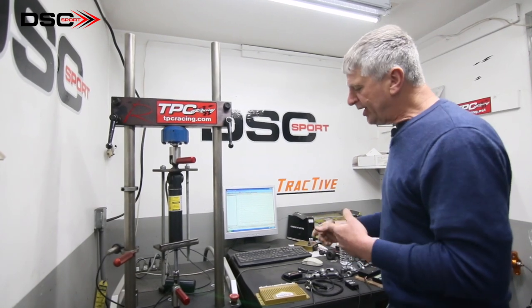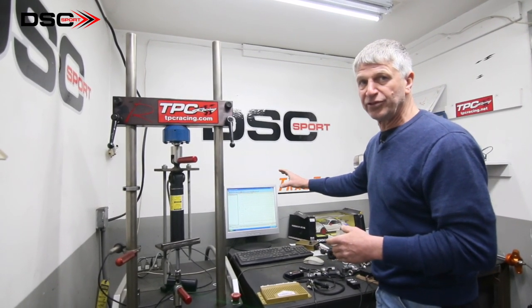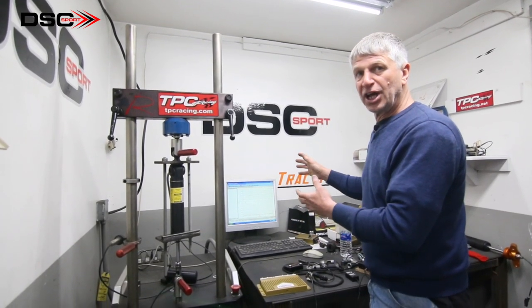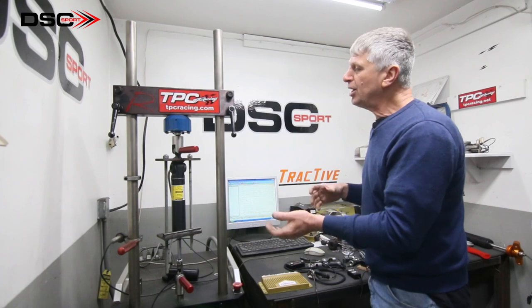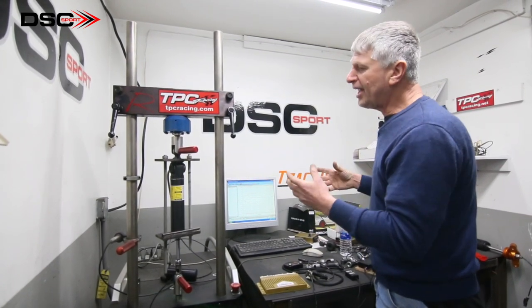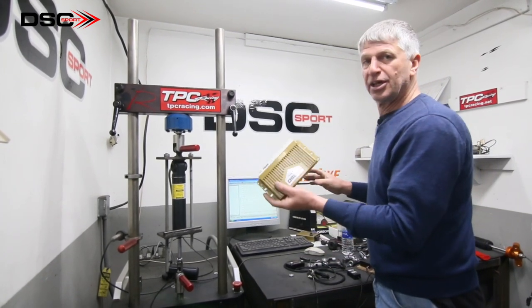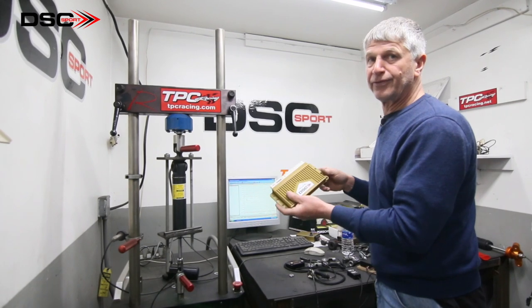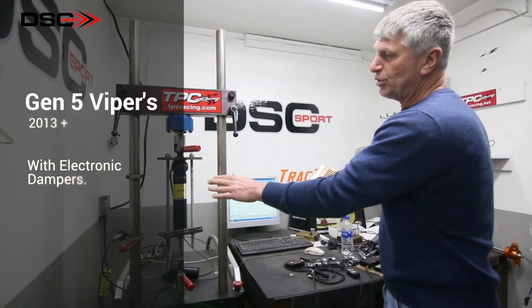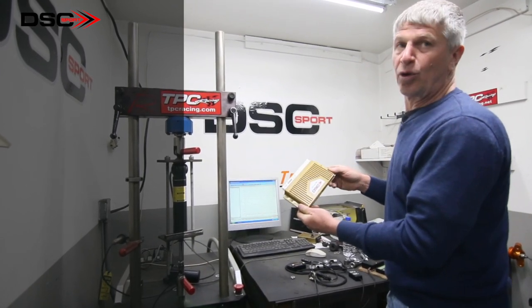What we are able to do is create a strategy in which we can combine the two different types of graphs that the shock can go through to get a good road race setup or a drag race setup — including a launch strategy for drag racing. There are a lot of things capable of doing with the stock shock by simply installing the DSC controller in your Viper, and this will work in all Gen 5 Vipers equipped with electronic dampers — basically 2013 onward.